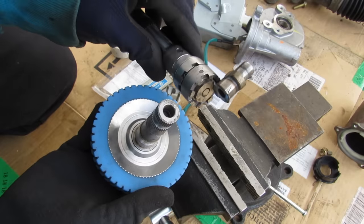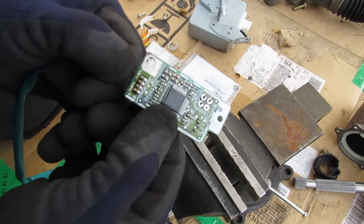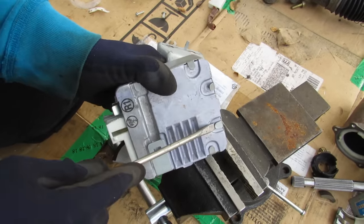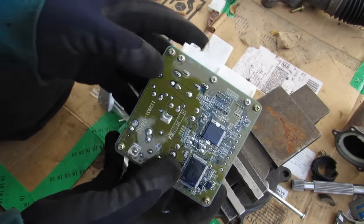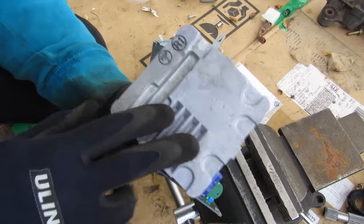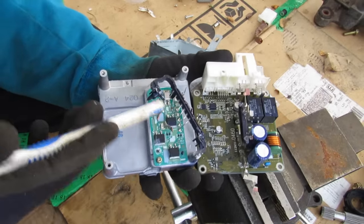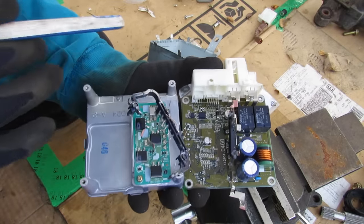This torque sensor is actually very similar to the rotary valve on a hydraulic power steering rack — click the link above to learn about that. In terms of the electronics, there's a processing chip and a bunch of resistors and capacitors for filtering, to change this into a usable signal fed to the steering ECU. Opening the steering ECU, there's a circuit board inside — the two big connectors come from power and go to the motor, with the larger contacts handling high current. There's a solid aluminum chunk that feels like a heatsink, some transistors, capacitors, an inductor, and a relay. I've read that the Prius EPS system — the steering ECU, motor, and torque sensor — can actually be transferred to other cars with no extra wiring needed, making it a pretty much bolt-on setup for anyone building a hot rod or go-kart who needs electric power steering.